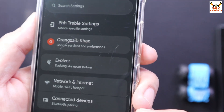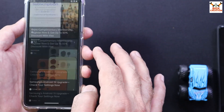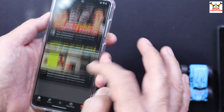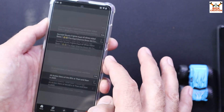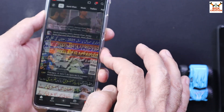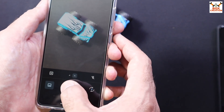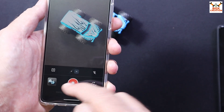The fingerprint scanner is not working, but face unlocking works perfectly. You will see good battery life and good speed after flashing the ROM on your Galaxy A51. I also tried the Evolution X GSI ROM on my Galaxy A73 and Galaxy Note 20 Ultra — the Note 20 Ultra booted but the Galaxy A73 did not. On the Redmi Note 11 it flashed but goes straight to fastboot on reboot. The AOSP camera is provided and works perfectly, recording video with sound on both rear and front cameras.